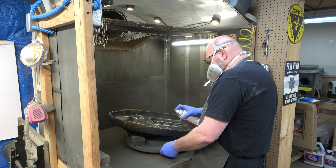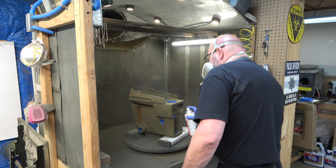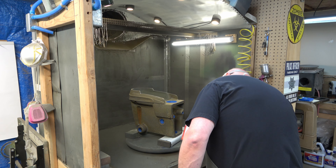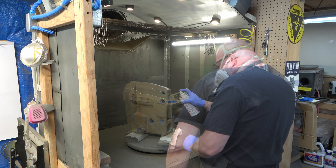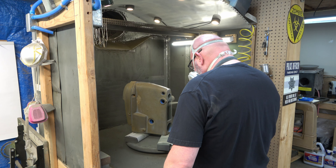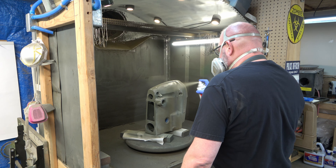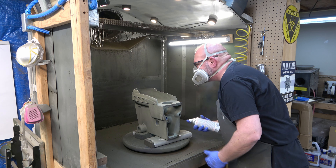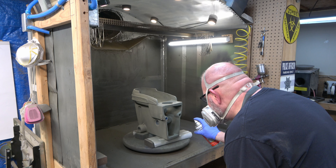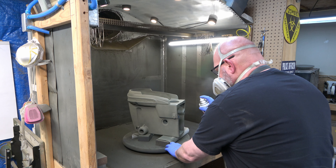And the same is true when we come back and shoot the paint on the head unit. Since there's a lot of areas inside that head unit that are hard to get to, I'll do the inside of it first as much as I can, and then I'll shoot the outside. That way, if I get any runs due to how thick I'm spraying it around the edge like that, I can just wipe that off. And then when I come back and shoot the outside, I'll put on enough primer there that it'll remove my fingerprint, if you will, of me wiping that.